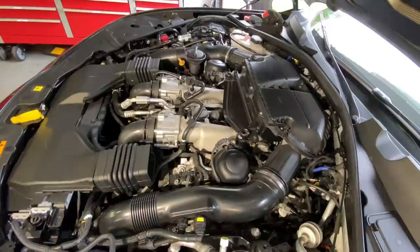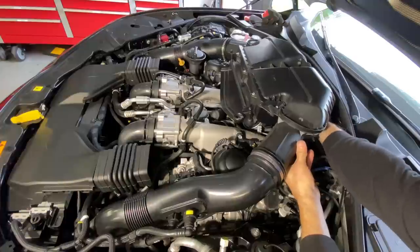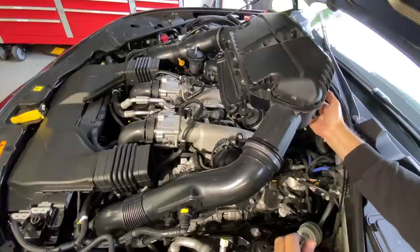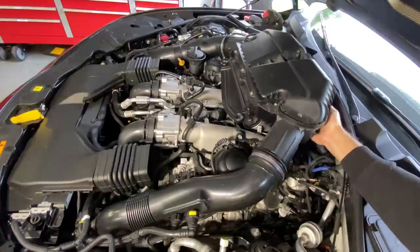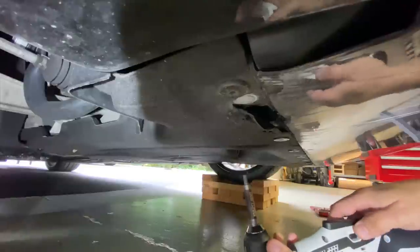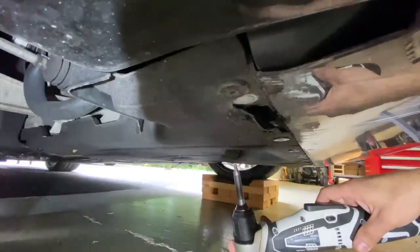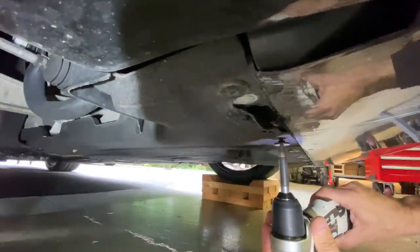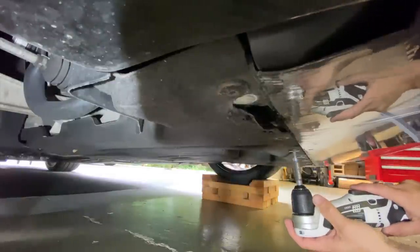I've released the clip on the passenger side. I can now lift the airbox assembly up and stick a foam yoga block under there so we can easily get to the oil filter. Under the car, I'm using my 90-degree Makita right angle with a T30 Torx, and I'm just slowly removing all the Torx hardware from the underbelly panel.